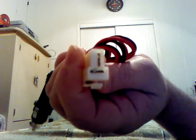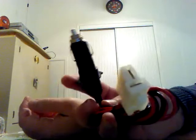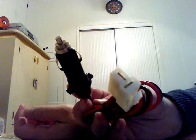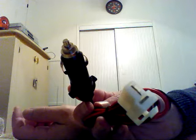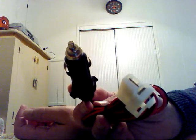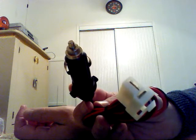but it said it was on the manufacturer's, but it's $8. They have other ones. Some have glass fuses. Some are a little bit thicker. Some are longer. But this is just a quick plug it in the cigarette lighter. Anything over like 10 to 15 amps draw, I don't recommend using naturally off a cigarette lighter plug, just because the fuses on them are usually max rated at like 15 amps. But something like this, or like a low power CB radio or scanner, or anything under like 5 to 10 amps, no problem, so I would use a cigarette lighter.